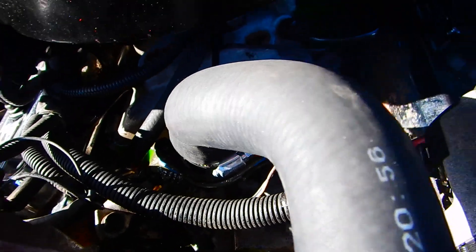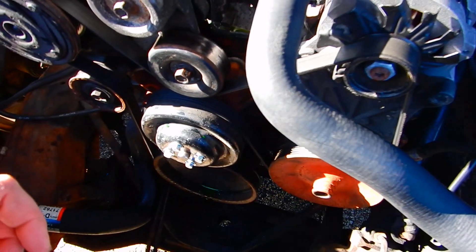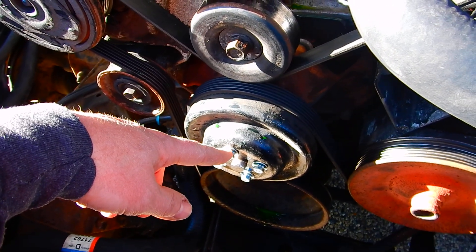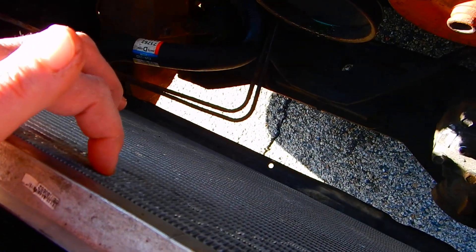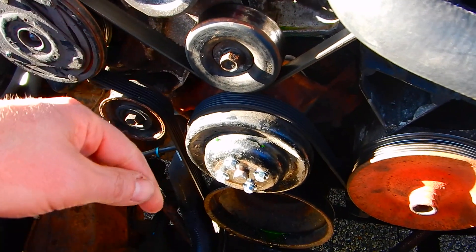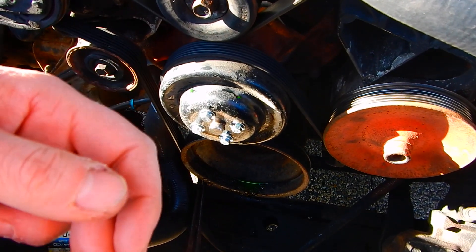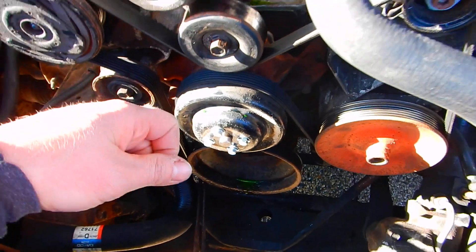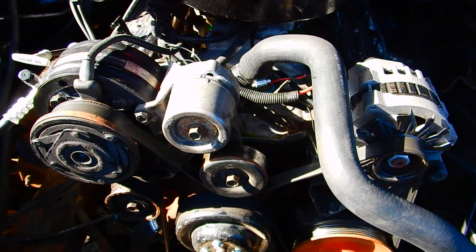You may have noticed I have my fan shroud off. While I was in here, I took the mechanical fan off the water pump and put studs in — I'm going to mount an electric fan on the radiator. That gives you about 20 more horsepower, and the electric fan only kicks on when it needs to instead of spinning all the time. You also don't have to worry about a fan clutch. Hope this helped you guys out, thanks for watching.